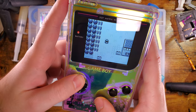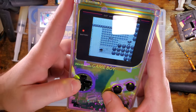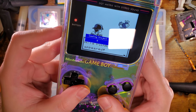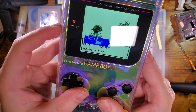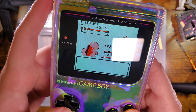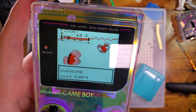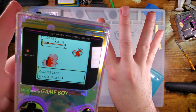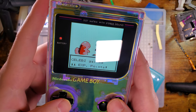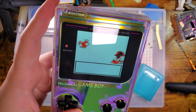I am where I usually am in this game — I don't know why I was confused about that. If your DMG is a Pokémon machine, you're not going to have any problems with this screen. It looks great. Oh, there are presets — look at that! It's not actually in color. What it's doing is the DMG supports four colors: white, black, light gray, and dark gray. So what this is doing is coloring the light and dark gray to pink and red respectively. But it actually kind of looks good — I like it.